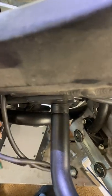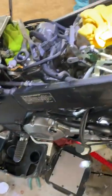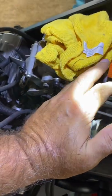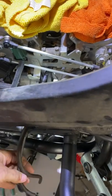What we're going to do in this bypass is extend those hoses. I made my rear hose a little longer and I'm going to label them so I know which is front and back. I'm going to use this Carb Tune kit that I bought some time back. The process is pretty much the same as synchronizing carburetors — we want these cylinders to each be fed equally for a smooth throttle, smooth response, and smooth ride.